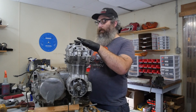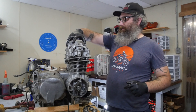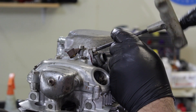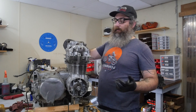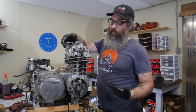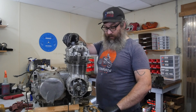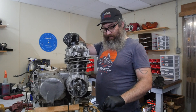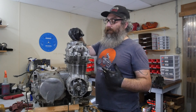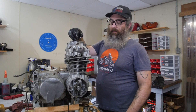I'm going to put the other breather cover on right here and tighten down the six bolts. New gaskets in place with a little bit of grease to help hold it. The very last thing to do before moving to the bottom side of the motor is to adjust the valves — they're all super loose right now, which is easy to do while the motor's in this state. Take your feeler gauges out, adjust the valves, then put your valve covers back on with new O-rings. The next thing we'll do is work our way down to the bottom end. So far so good — as far as the top end goes, I'm really happy about what we see.